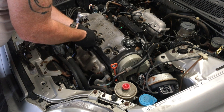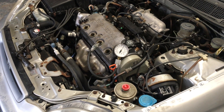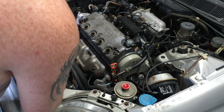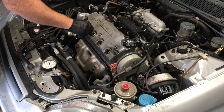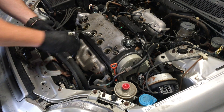Alright, I've got it sped up. I'm going through cylinders one through four — cranking each one for about 10 to 15 seconds, then checking the reading. There's a little relief valve on the side of the body; when you see me pushing it, I'm just dumping the pressure out. The first three cylinders were about 195 psi, and I think cylinder four was sitting down around 180 to 185 — a little low, but nothing too crazy.